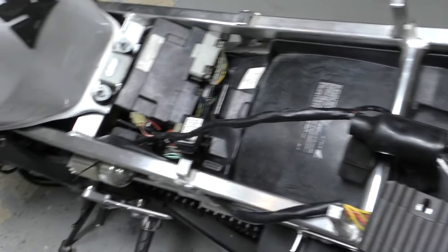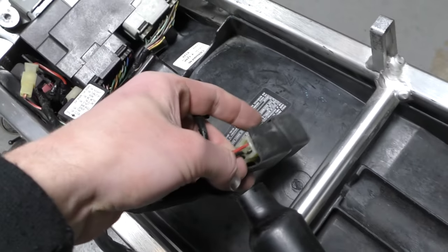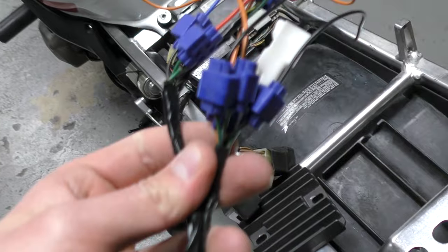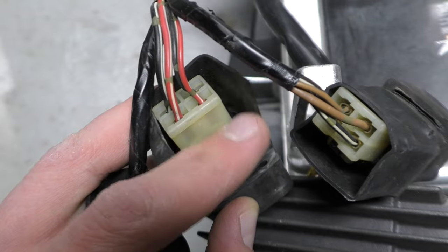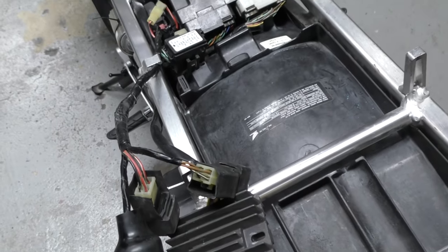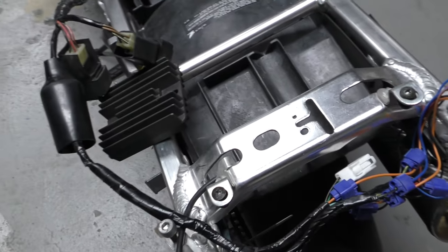The second method is highly recommended if you're doing a naked bike — no fairing, no headlight. You want to come back to the rear part of the harness and find your engine cut relay right here. You should have a bunch of ground wires here, the green wires. Take the bottom right red with white, cut it, solder it to any one of the ground wires available back here, and that bypasses the tip sensor. You don't have to do anything with the main harness up front or cut any of that — you're just doing it all back here.